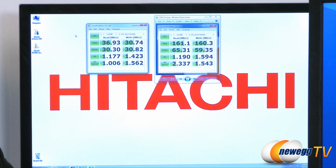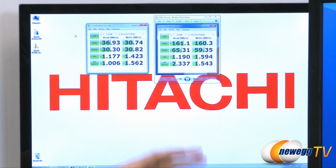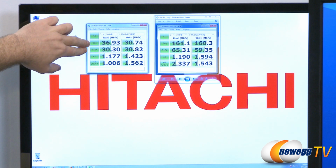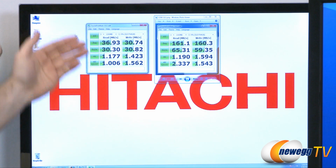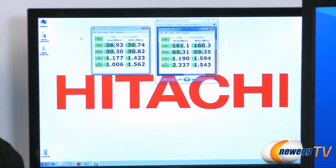I'm not sure actually which specific hard drive internally Hitachi is using inside the XL3000, but I would guess that they might even be the same one. Because here, the limitation we're seeing is the drive itself being able to access those 4K chunks of data on the platters, versus up here, you're seeing the bandwidth bottleneck from USB 2.0. So the drive itself is nice and fast, just connecting at USB 2.0 speeds. That's the type of performance that you will get.